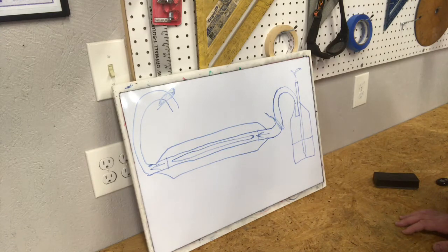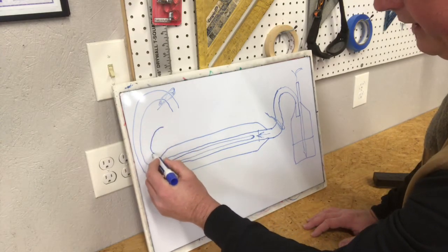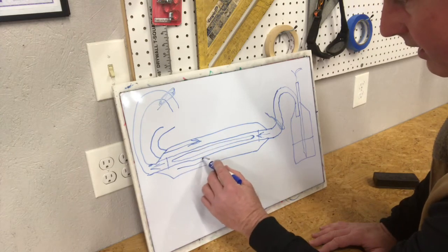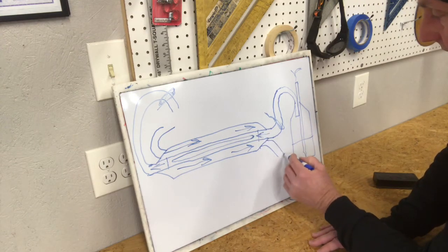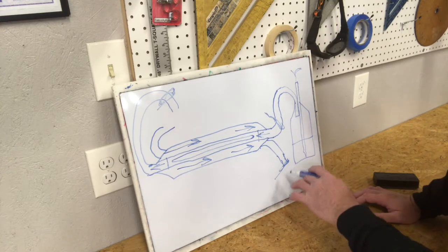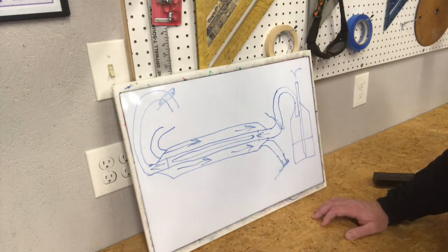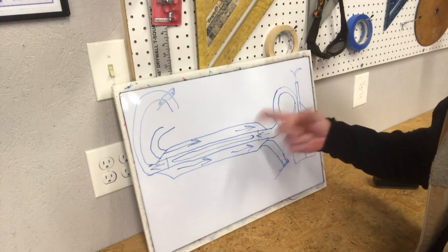Now what Pantone's claim was — this made a fuel reactor because he took the exhaust side of the engine and ran it on the outside of a chamber that went around this pipe. We had exhaust gases flowing this way all the way around this pipe, and then an exit up here for the exhaust. We had a ball valve to regulate back pressure, and we also had that other little thing where we tried to heat up some motor oil, but that never worked. This is the theory behind it — you got intake gases going this way, exhaust gases going that way, and supposedly this creates some type of magnetic field that makes this rod float right in the middle of that center pipe.